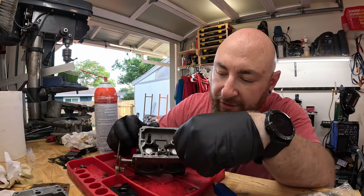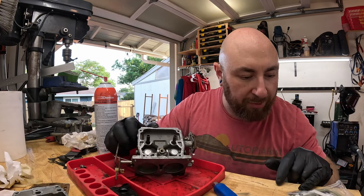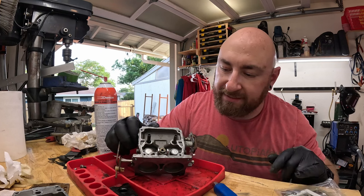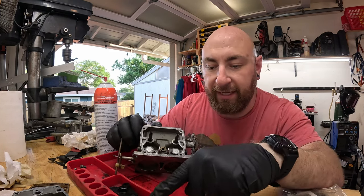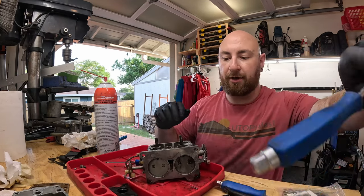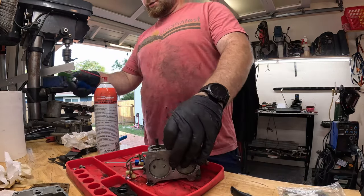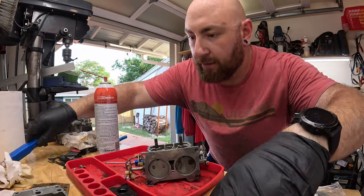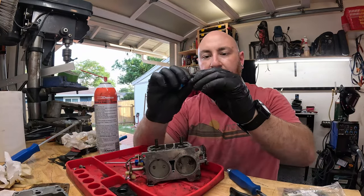And now if you look in here, you can see there's two sealed plugs. We have new plugs, so presumably there's something behind them that's important. And then we have this, which meters fuel in against, this is the seat for the needle I just showed you. So if we grab our big screwdriver, there we go. Just need to find the biggest screwdriver. So we can remove that. And now we're gonna clean it.